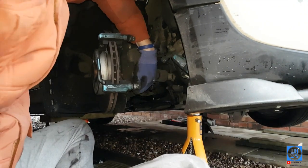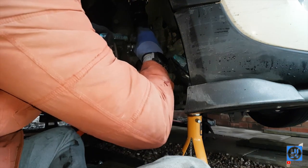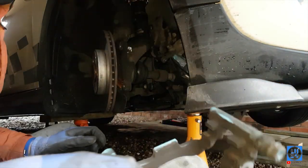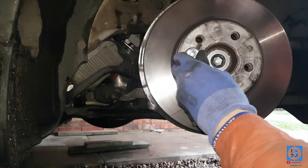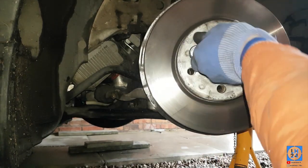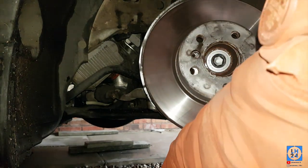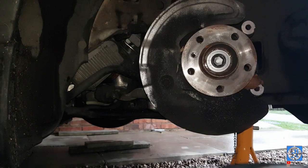Keep your hands stretched and make sure you're loosening not tightening. Simply unscrew both bolts and that's your caliper hanger off. Now use the little 6mm Allen key to get the disc retainer screw out. This is what I mean — if you hadn't loosened this first with the caliper still on the hanger, you'd have big problems. So that's the disc off.